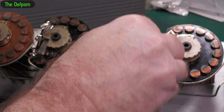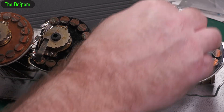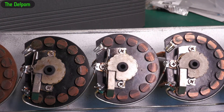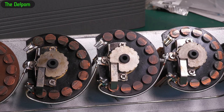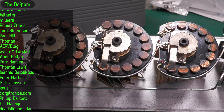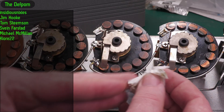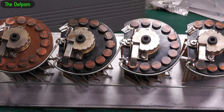So I think I need to basically go around and clean this grease off, maybe polish them up a little bit, and then reapply something on there. I do have a little bit of dielectric grease, though I'm not sure if it's the best stuff to use. So 7 — that's 10, 9, 8, 7 — that's the one that was playing up the most. So I'm going to clean all these off; you can see it's green. It's obviously the oxidization from these things. I'm going to clean all these off and then put something on there.